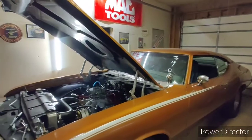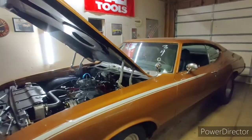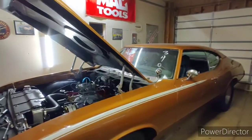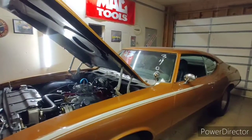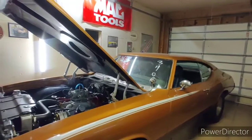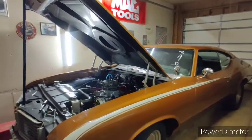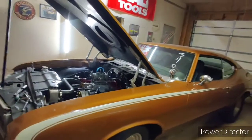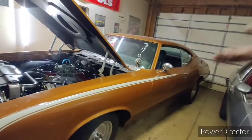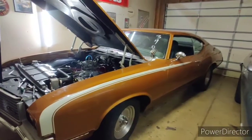I'm going to add some bump stops and do some measurements tomorrow. I keep going back and forth — I mentioned to JJ I was going to change the converter, but I thought about it and decided that's a lot of work and we still have a little time. If I really feel I should go back to the other converter after this outing, we've got another couple of weeks before the tracks close. For now I'll just take it out as-is and fiddle with bump stop heights for the suspension, which might help if the car bites and the chassis moves out right.